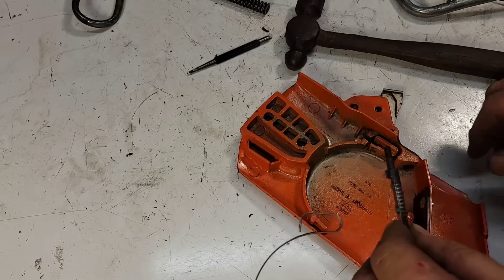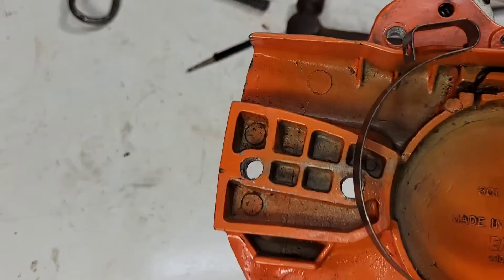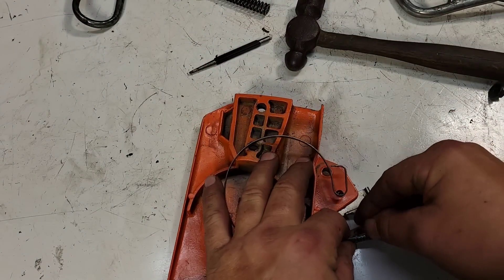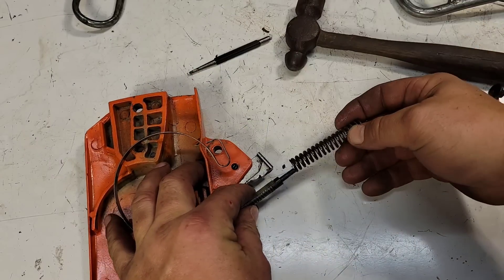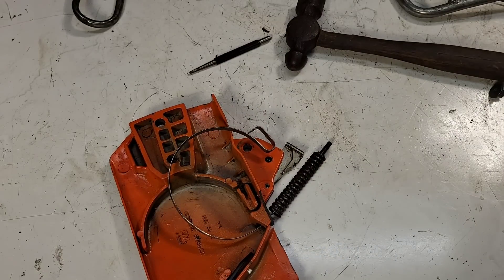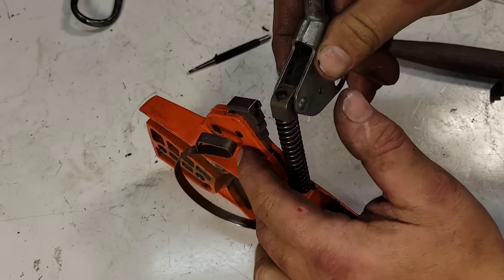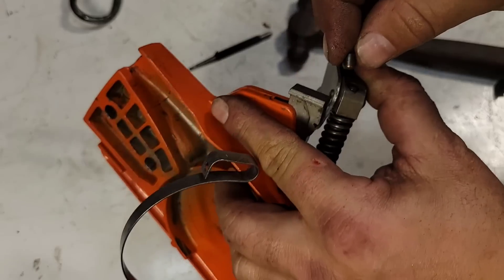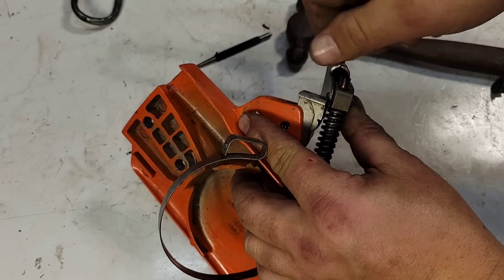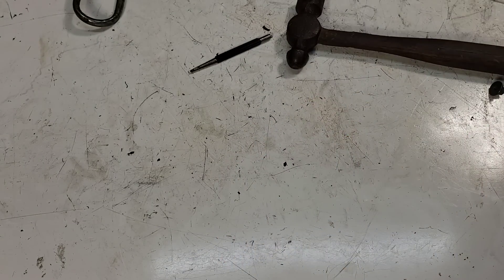I picked this band — this is a solid band, this is a slotted band. I prefer these solid bands; they're the newer style. These slotted ones tend to kink — see how that one's kinked versus that. I'm going to give Hogan the solid band. Now this is the part I usually screw up a little bit. I put this through there, weave it through there, put this there, spring — there's this bushing, don't forget that or the spring can bind up. Put the spring on there, take this, drop it over, and just snug it up with that little screw on top.